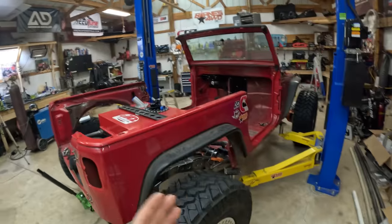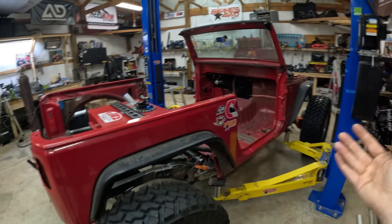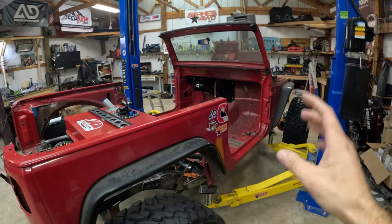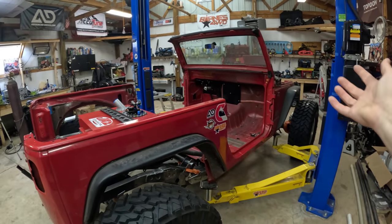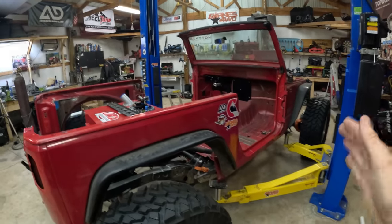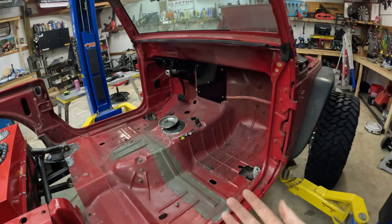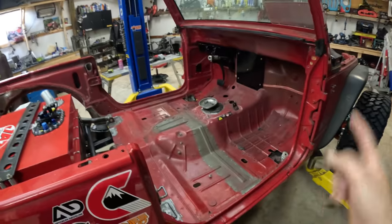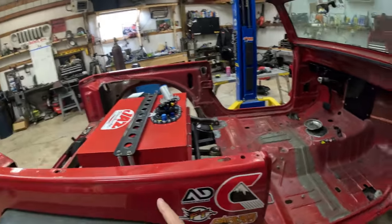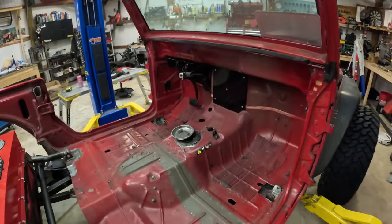The sixth point is having a six-point roll cage. Ultra 4 rules say we have to have a six-point roll cage tied into the frame. You can run a body-mounted roll cage - not the kind you could buy from a Jeep modification dealer. It has to actually tie into the body in certain spots, has to run sandwich plates of dissimilar size. But typically running straight down to the frame as your termination spots is going to be the strongest and best way to build an off-road roll cage.